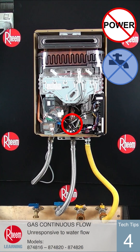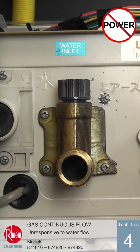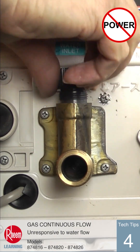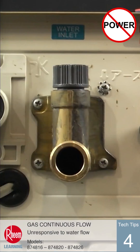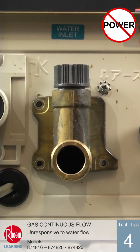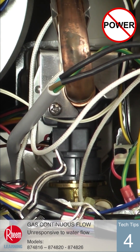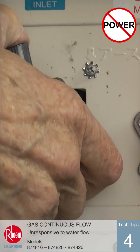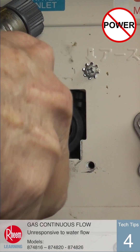If the test voltage is incorrect, the inlet water valve will need to be examined as the water turbine may be jammed. Check the condition of the inlet water strainer at this point to ensure foreign debris has not passed through, causing the issue. If the strainer is damaged, it will need to be replaced and the turbine can be removed next and checked. Turn off power and water to the unit, disconnect the inlet water pipework and remove the screws securing the inlet water fitting to the base of the unit. Remove the stainless steel spring clip from the base of the water valve. The inlet fitting can now be pulled down to remove from the water valve, which uses an o-ring. Once this is pushed aside, use pointed nose pliers to reach in and remove the turbine assembly.